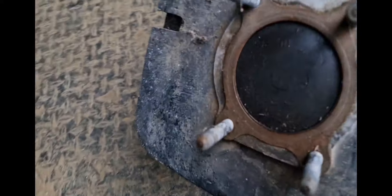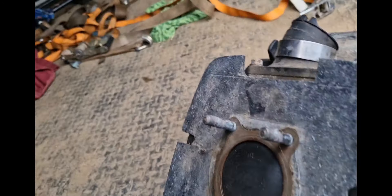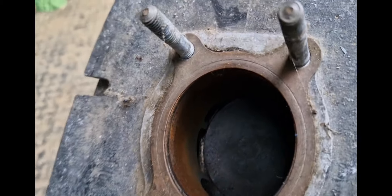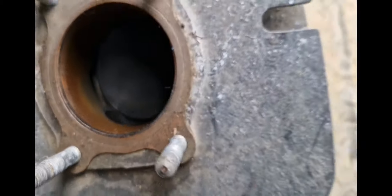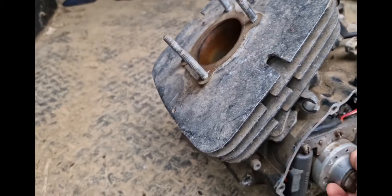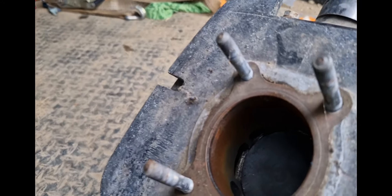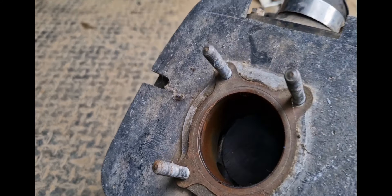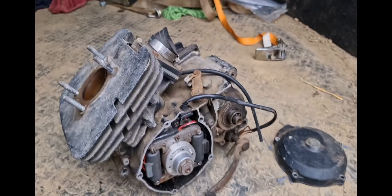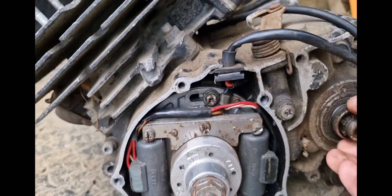It's got a 1mm over piston, so there should be more life left in the bore. The bore has got a bit of rust in it. Obviously the engine's turning over, as you can see, turning it over with the flywheel. The bore's a little bit rusty, so at minimum it's going to need a hone. You're going to want to rebuild the engine, to be fair. You're obviously going to need a head. The inlet manifold is cracked, and it's going to need new seals and everything.